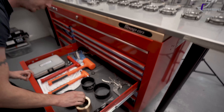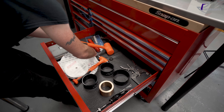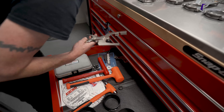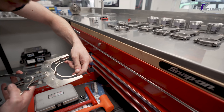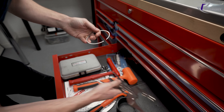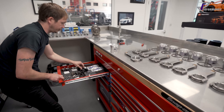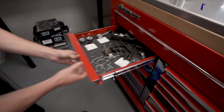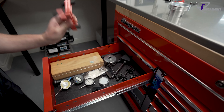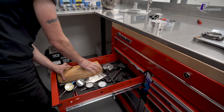That's the one we used for the C63, that's a Yamaha one for our six-cylinder engines. Degree wheels for when you're timing cams. A piston ring removal tool — I find it a little bit clumsy. Essentially it'll open a ring up, but I haven't really got on board with it. Locking tools for the different engines we do. For measuring piston height, another ring squaring tool, one for putting valve stem seals on, and a couple of different ball DTI gauges.